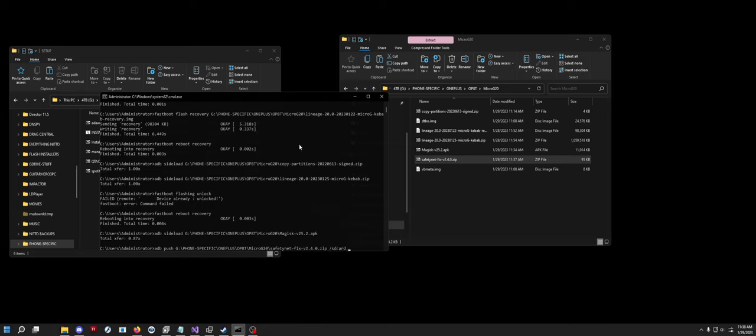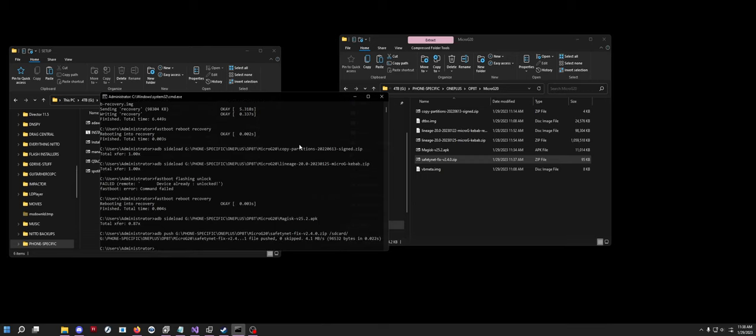SD card. Now, the one thing is, when you install Magisk via custom recovery, you do have to be on Wi-Fi the first time you open it or have your SIM card in the phone so you have cellular data. Don't freak out also if, when you first put the SIM card in the device after flashing this ROM, you don't have mobile data. It's because it's disabled in settings. You have to go into settings, select network settings, go into your SIM settings, and enable cellular data. I'm on Wi-Fi now.